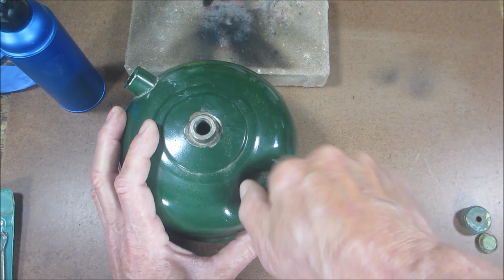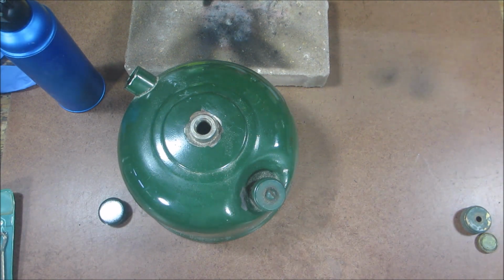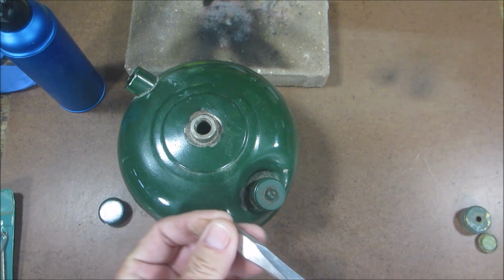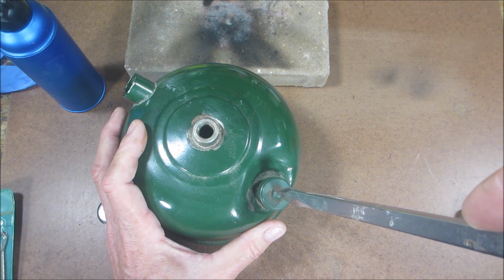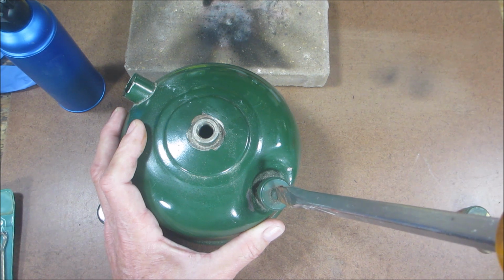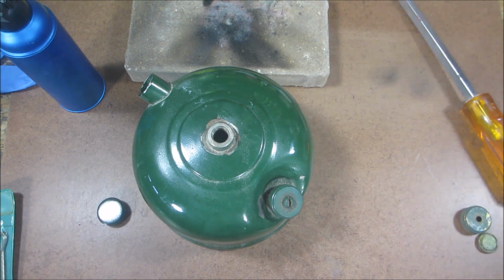and you're going to want to put some pressure on that, very, very tight. Then you're going to get yourself a nice slotted screwdriver, one that fits that screw very tightly, because you always use the right size screwdriver for the job. Start turning it. Now I could feel the insert is turning. So that means I don't have it tight enough.